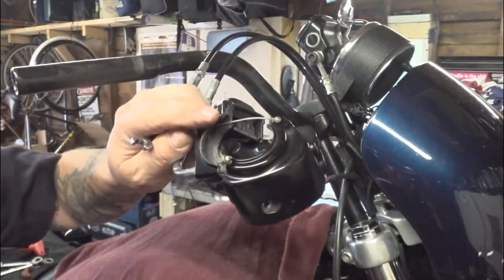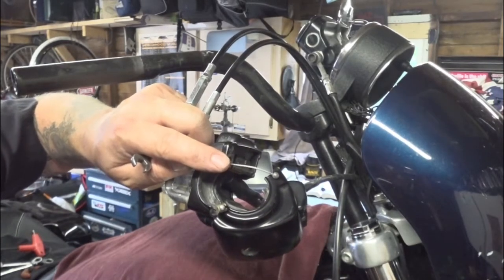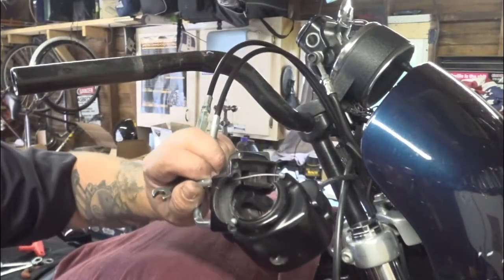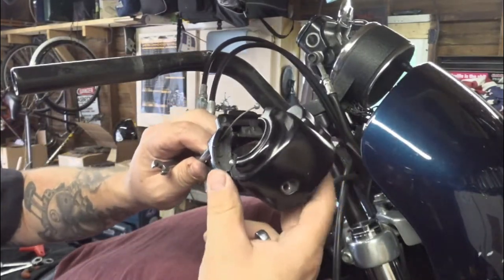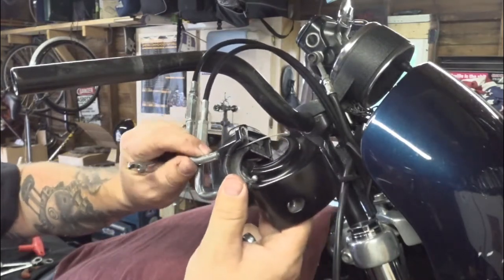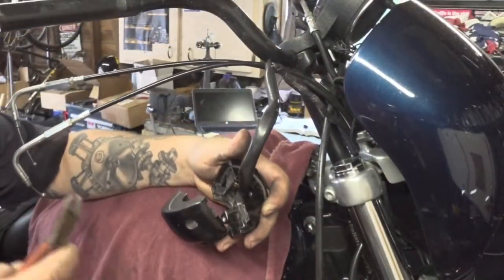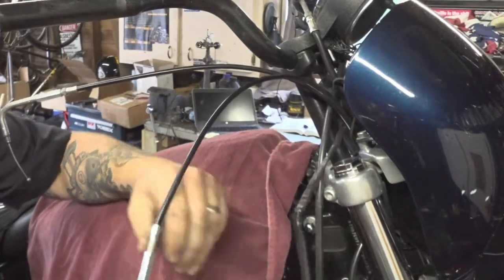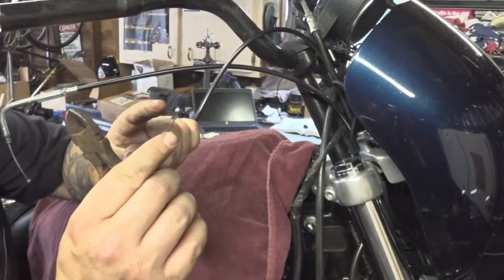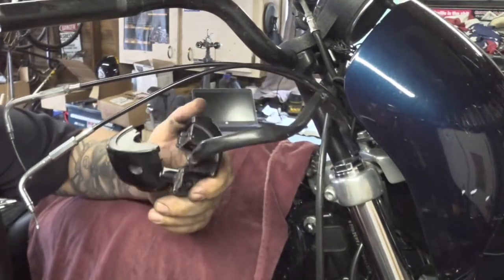Go to your actual pull throttle cable — that pops off the little notch right there the same way. I can then slide the pull cable out of there. I got the throttle cable out; took a little while and had to fight with it. On the pull cable, there's a little retainer clip — I had some crap underneath it and it had been pushed out so it wasn't allowed to spring back in. A small flathead screwdriver and I got it out of there.